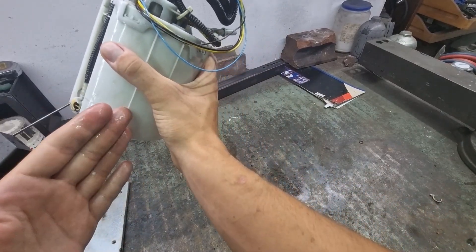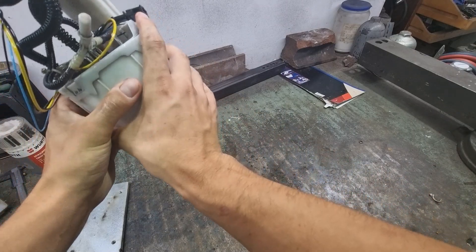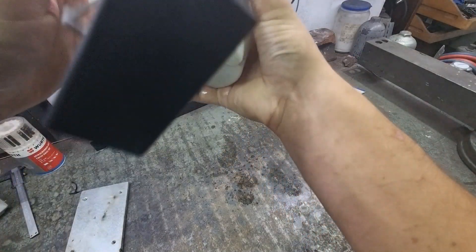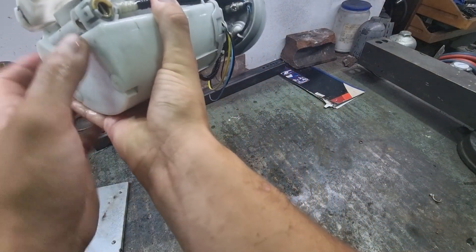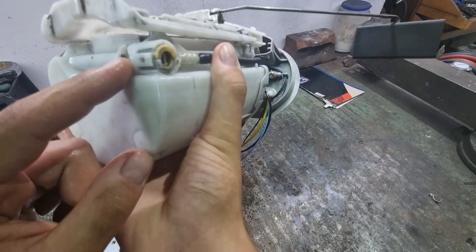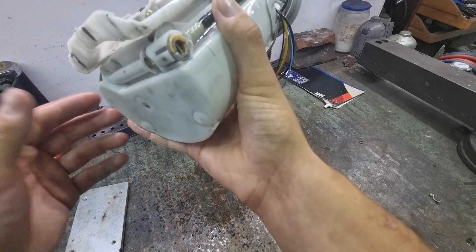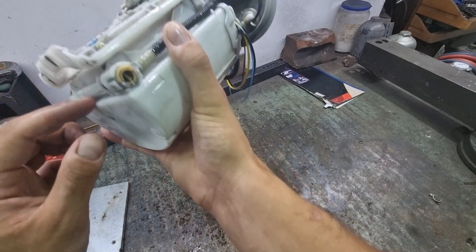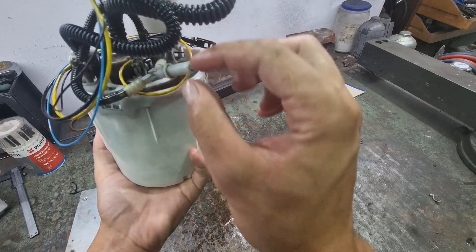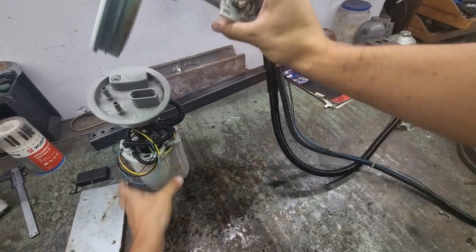How does fuel enter this housing? There's a small hose — this is also a pressure side from the fuel pump. It goes into this piece here, and one part goes into this hose. Here you can see a small ejector. Fuel goes into here, there is a check valve here so fuel can enter but can't leave. That's how the pump sucks from the right half of the tank. This small-diameter hose goes into this piece, which is located in the left section of the tank.